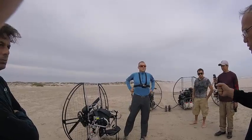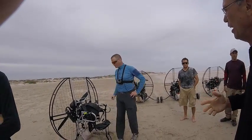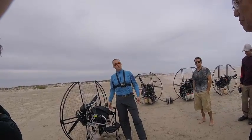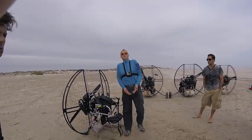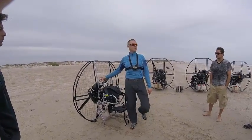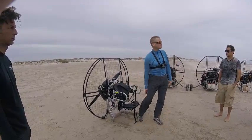If the engine is bogging on you when you throttle up, and it keeps bogging even after returning to idle, you've got a major issue — either the tuning's out of whack or the carburetor's gummed up and not getting fuel. It's generally not a spark issue because a coil either works or it doesn't — if it's spark it's usually just completely dead. So it's usually a fuel issue. If you can't fix it with tuning, replace the carb with a new one. A brand new carb is around $265 — it's not worth messing around with a troublesome one.